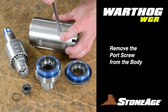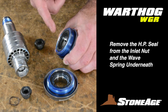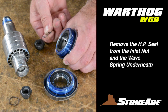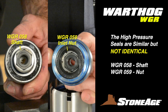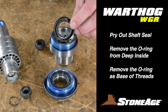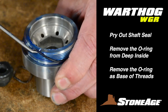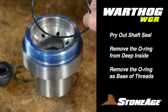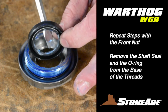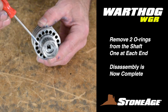Start with the body and remove the last port screw. For the inlet nut, using modified snap ring pliers remove the WGR 059 high pressure seal and wave spring underneath it. These seals may look the same but they are different — the WGR 058 HP seal is for the shaft and the WGR 059 HP seal is for the nut. Use a slot screwdriver to gently pry out the shaft seal; there is a small O-ring down inside. Use a pick to remove it and the O-ring from the base of the threads. Repeat with the front nut: pry out the shaft seal and remove the O-ring from the base of the threads. Finally, remove the two O-rings from the shaft, one at each end.